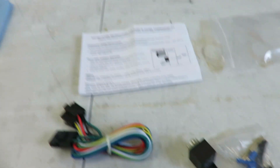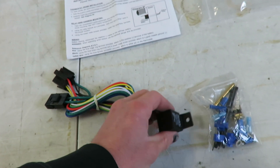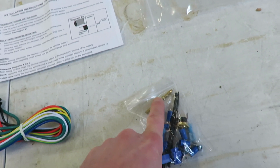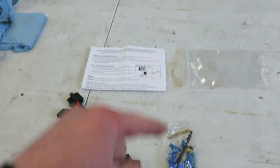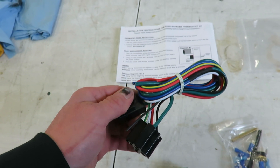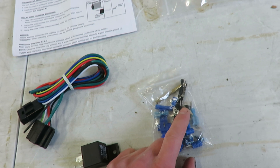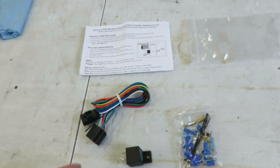So today what we got going on is an electric fan and the wiring kit to wire in that fan. This one comes with a relay, the harness, and I went with the one that has the probe that you stick into the radiator. I've heard pretty good things about them so I figured I'd try it out - I'll link this stuff in the description box. This one is 200 degrees on and turns off at 185, which is about what the factory Volkswagen does. They have a two-speed fan but I'm only gonna wire in one speed.